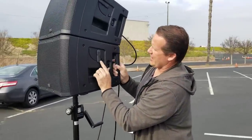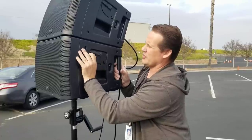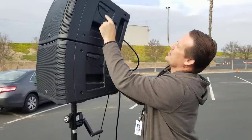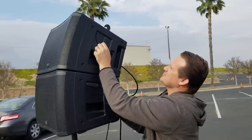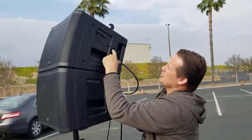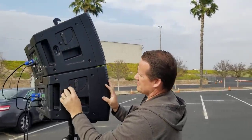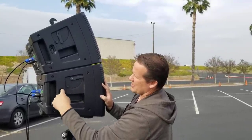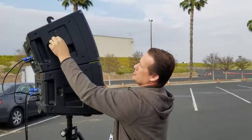Once this is all the way back down, go back down to the speaker — there's a little slide. You push up on the slide; you might have to give a little bit of force, but once the B slides through, then you pull the C down. So if you look at the top speaker: push up on B, that lets the hook back, then you pull C down and that pulls the hook in. Repeat that on the other side — push B, it may take a little bit of force, then pull down C and that'll pull the hook in.